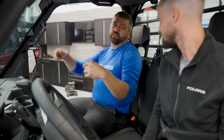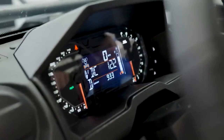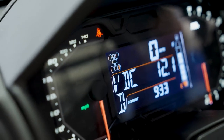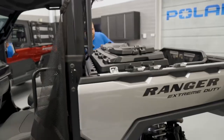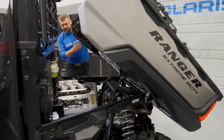When you're back on the grass, you're not tearing it up because you've got your rear differential unlocked. For trail riding, you can get that front end to pull you around corners but still get a tight turning radius with the rear end unlocked and easy steering effort. It's not just one-wheel drive - it's actually two fronts plus one rear, so you really get quite a bit of traction. The gauge will actually show you what's engaged and what's not as you toggle through the different modes - really easy, intuitive, and customizable.